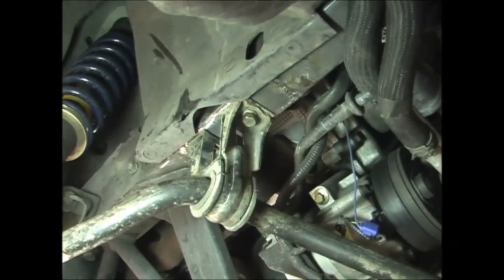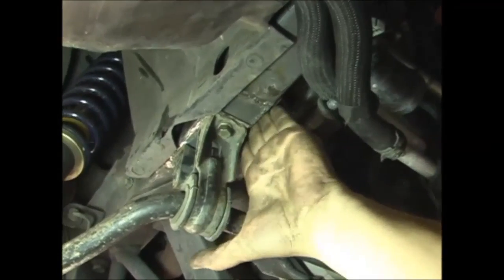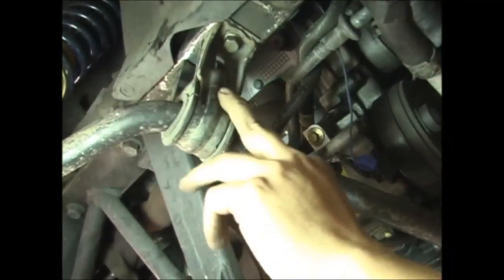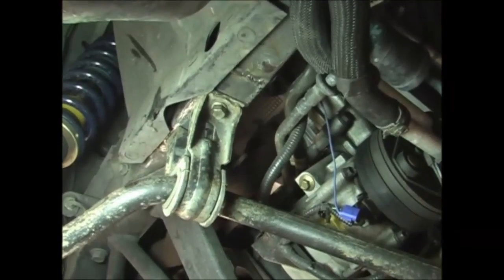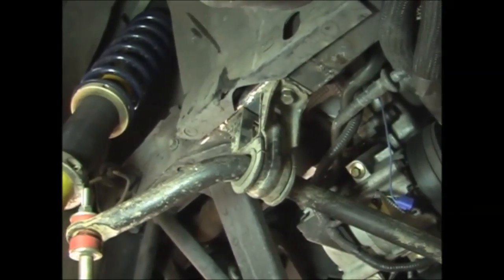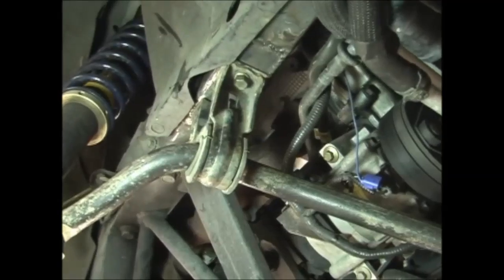I went to this because to put this engine in a Fox, you have to cut the Fox sway bar mounts off. Tried to make brackets, they just wouldn't hold up. So the reason I went with this bar is because this year car is mounted right to the frame rail. The only downside is the bar is about an inch wider on each side, so you lose some turning radius. But it's not bad, considering you have a working sway bar again.